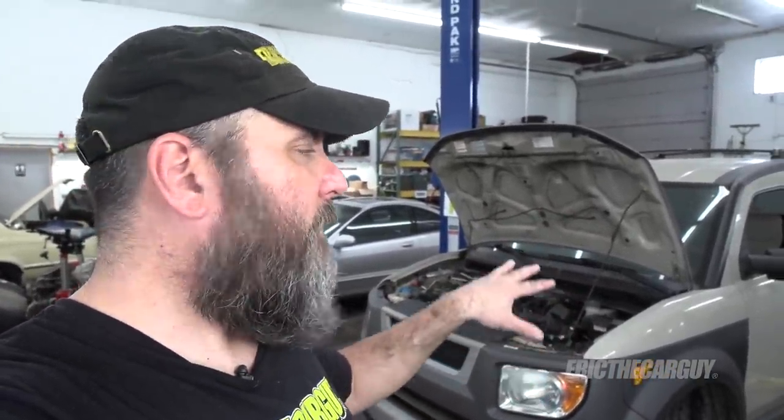The plan is to put all four wheels back on. I'm leaving the old tires on for now — I want to let the Element sit on its own weight with the new coil springs for a while and maybe even drive it a little bit so that stuff settles first before I do the alignment. That will affect ride height ever so slightly, but if it's all compressed and settled when I get the alignment done then it won't change — at least that's the hope. After installing the wheels I'm going to go in the back, tighten everything down on the ground, then go out for a little drive to see how it feels.